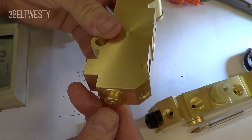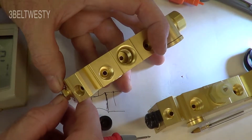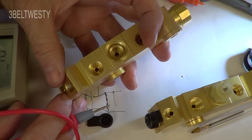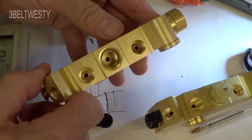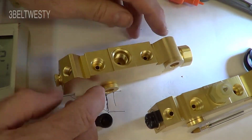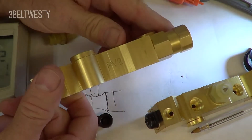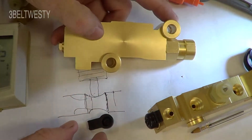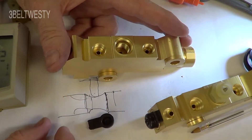That sure looks like it's coaxial on there. Somebody said this pin comes out if it's been moved over — if that's the case you could push it back in to restore flow out of the front. If it went the other way, I don't think there's anything you can do. The OEM ones for the car have the same function but they're not solid brass — they look more like iron casting. It's labeled PV2 and takes something like 400 to 500 PSI to move this back.